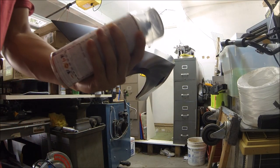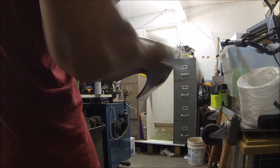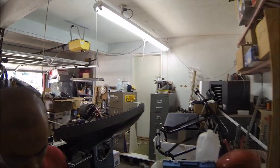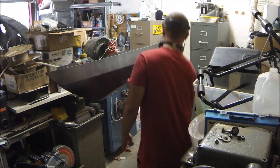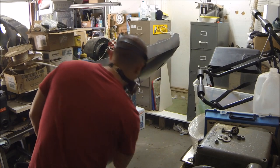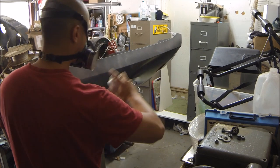This is the can of spray paint I'm using — I got it off eBay, it's a custom mix. The original mix I had was a little too dark, so they gave me a lighter version from their database. The first coat is just going to be a very light coat. I moved the camera further back so it doesn't get any overspray on it. With certain spray cans, make sure you're spraying horizontally at all times — when you spray vertically the pattern just doesn't come out right.